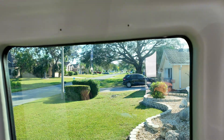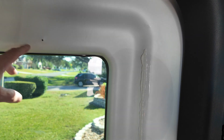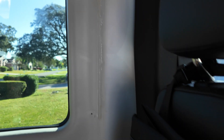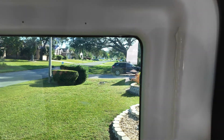So we took it off and I'm going to show you what the window looks like with it off. This is what it looks like on my side window in the dinette area — it just had four screws and the thing moved and it rattled and it wasn't good. So the steps for this: we're going to clean that up, put Velcro all the way around — it's got a couple of screws that help hold the Velcro — and then it's this zippered canvas insulated piece that goes over it. There's no screen on this one because that window doesn't have a screen.